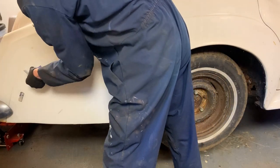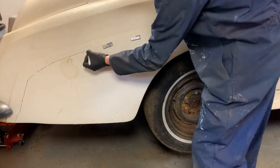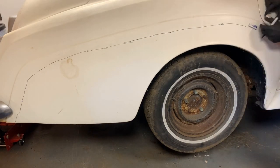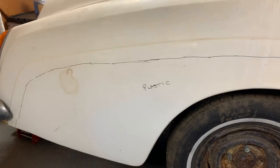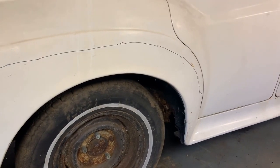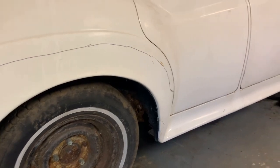The car had fiberglass front wings — they were S3 wings but it's an S2, so they don't actually fit because the grille is a different height. I took them off. You can see there is a lot of plastic in the body which I need to sort out. The rear wings — the bottom element is all just fiberglass that's been riveted on.